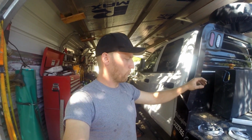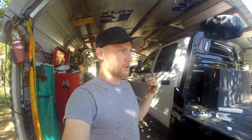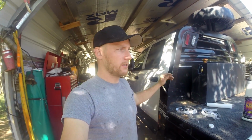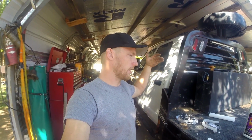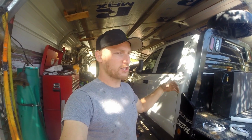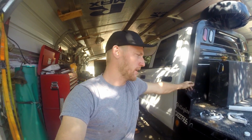The main thing with this, you get your extra quart of fluid in there. That helps with your lubrication and cooling process. You've got more fluid in there, just like a deep dish pan on your automatic. So this is just taking the fluid level up. It still allows enough room for heat expansion to go up and down with the temperature changes of the fluid.